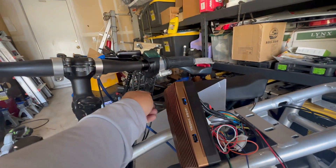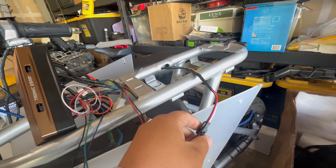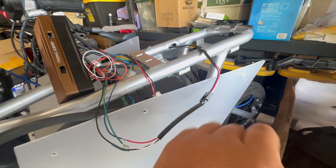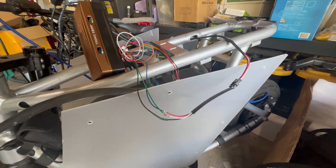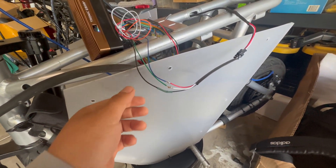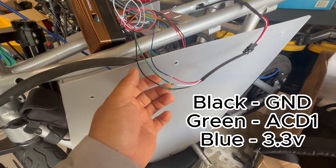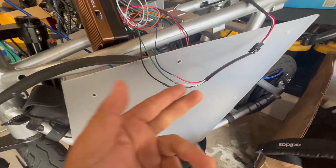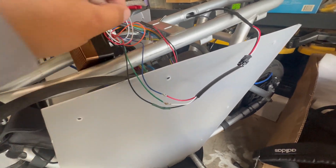When it comes to your curved throttle, if you want to be neat, run a connector so when you disconnect or reconnect it, it's easy to pull out without chopping any wires. When running your throttle, black goes to black, green is your ADC1, and blue is your 3.3 volts. Use heat shrink to give it a cleaner setup and look.